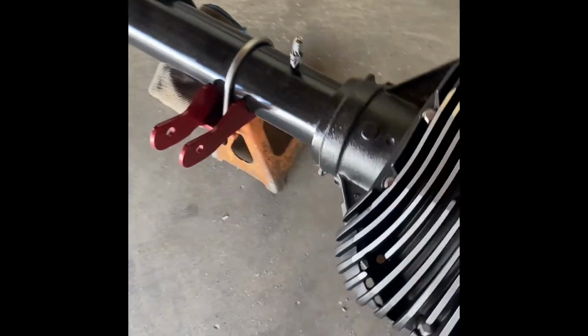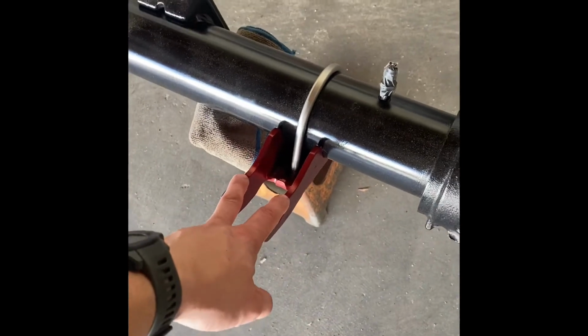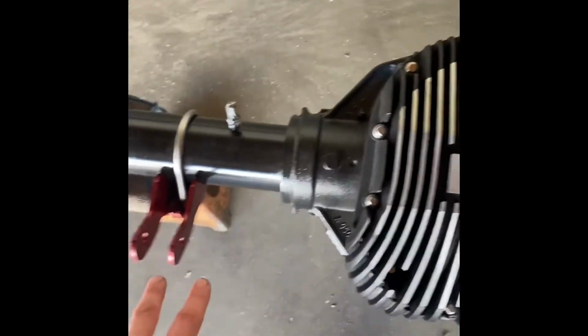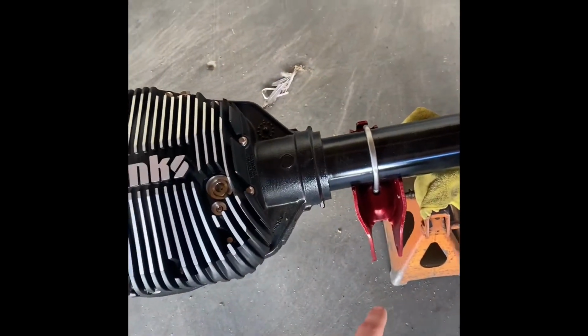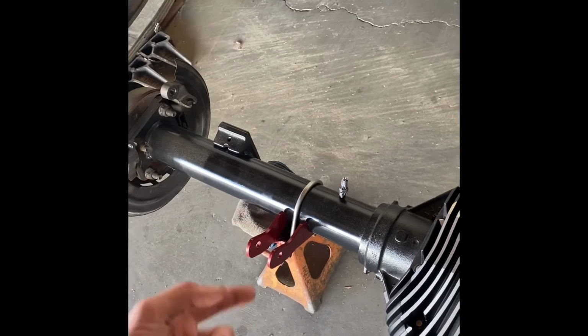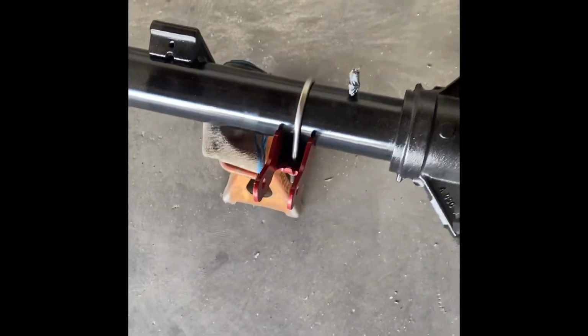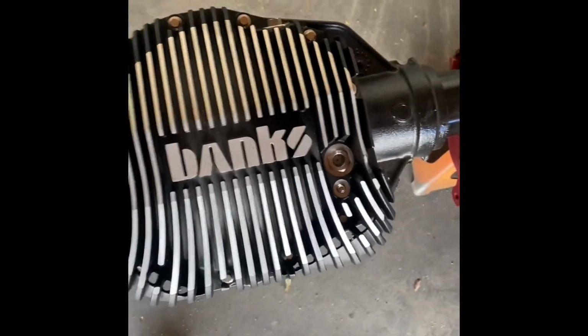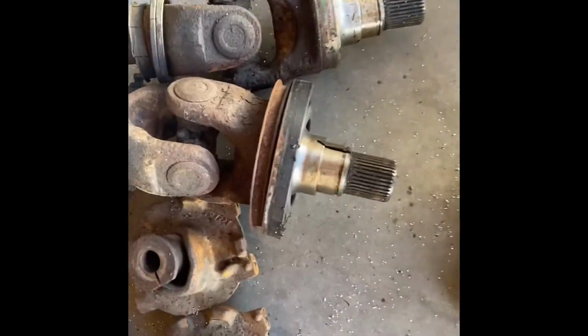Now for the ABS, I believe on the axle on the truck now that both shocks are facing forward, I'm probably gonna have to modify where the top shock mount on the driver's side is, but we'll figure that out. I've heard this helps with axle wrap, so we're gonna actually leave it like that, but it's freaking beautiful. All right, so we got the hubs cleaned up. We'll start taking these U-joints out of the drive shafts, or the inner axle shafts.